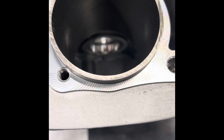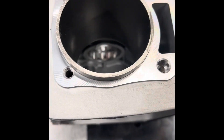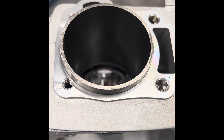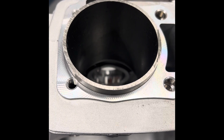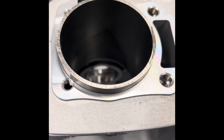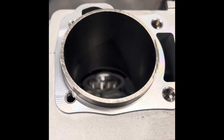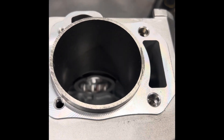You will have the most power, the best ring seal — and that's how you make power. The cylinder bore strength, the best sleeves with the best rigidity — they don't distort. And this is running at almost four times its minimum thickness. If you've got a 2.990 bore, it would be almost four times as thick as the minimum requirements.